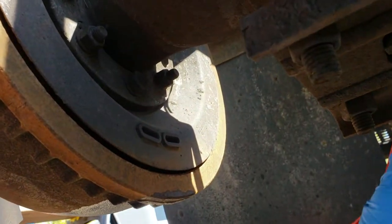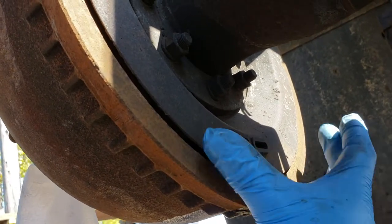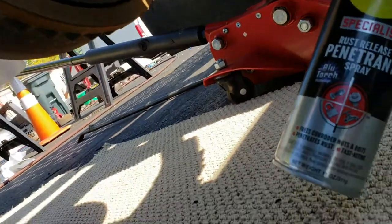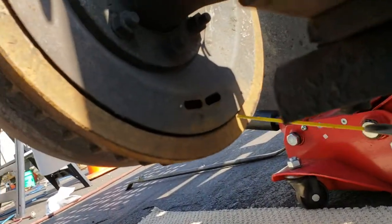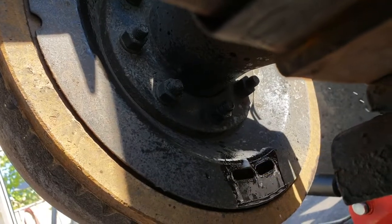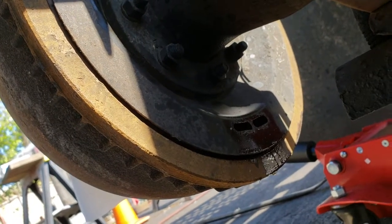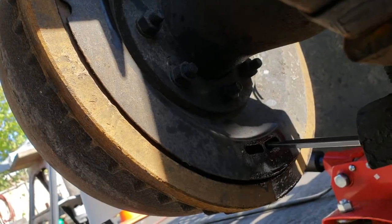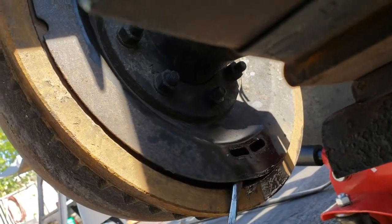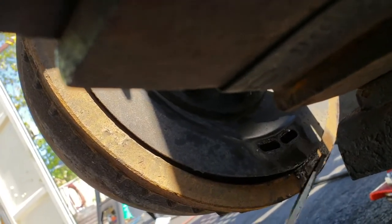This is how the back of the drum and brake system looks. We need to work right here and use a screwdriver to release the shoe so the shoes get closer and the drum comes out easier. We'll spray WD-40 inside to help parts turn better. Since we're removing the drums and electric brake system and throwing everything away, another approach is to pry and bend out this plate to give more space and make it easier to see what you're doing.